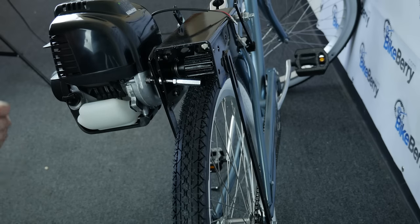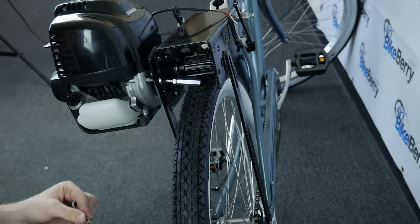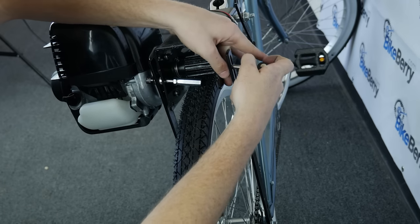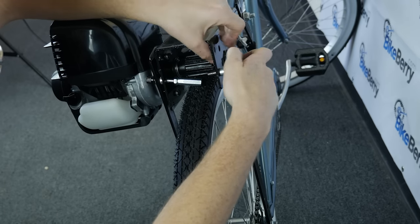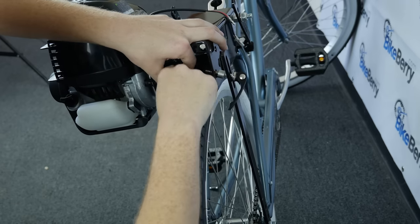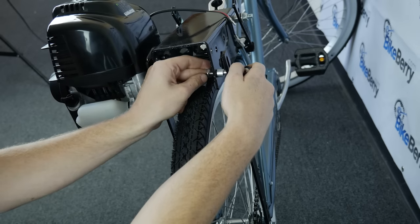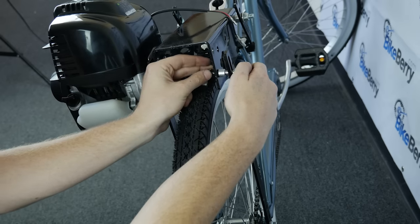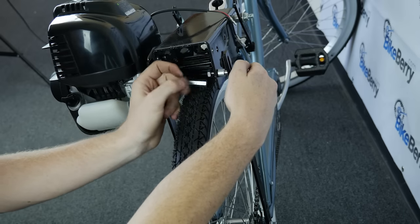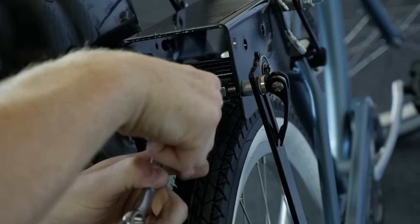Let's put the quick-release lock on the back, similar to the front main bolt. Slide the bolt through. Be sure to put a spacer between the side mounting plates and the main mount. In some cases, the spacer on the engine side may be too large — if so, just take a file and file it down slightly and it should fit perfectly. Be sure that the release handle is on the opposite side of the engine, and that there is a nut on both sides of the middle bar.